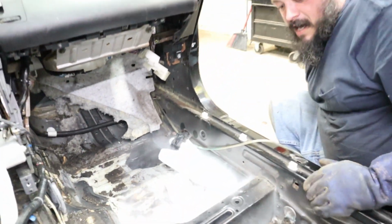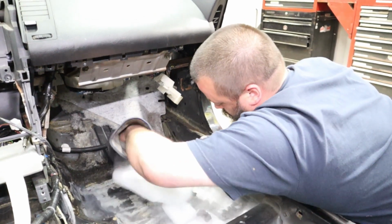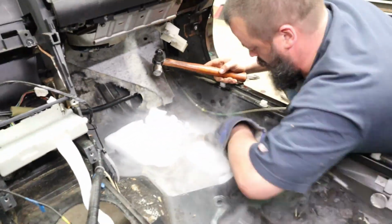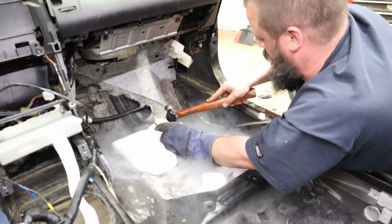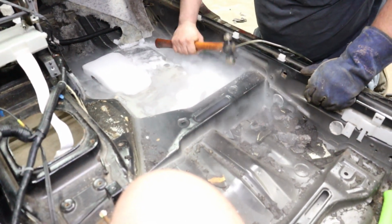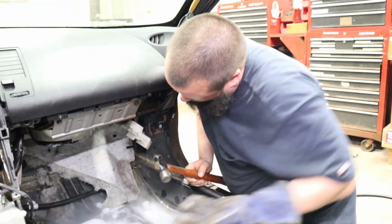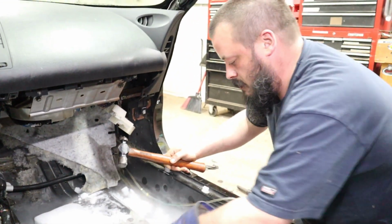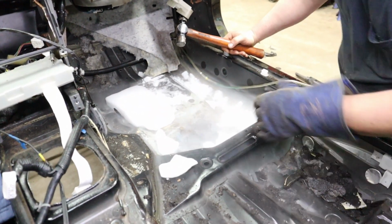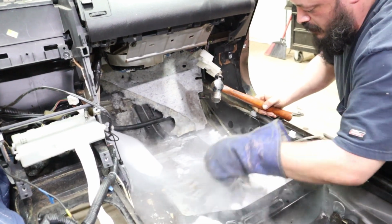Yeah, it wants to if it gets cold enough. So I'm going to crush all this up and I'm going to pack it on this whole area. And I bet you it comes out no problem. So I would definitely say you want to crush up your dry ice and then just pack it down. Throw a coat or moving blanket, something like that, on top to keep the cold in. You can see it evaporating out. When you throw a coat on it, it doesn't do that. It insulates it and keeps the cool temp where you want it.